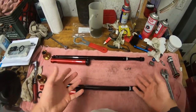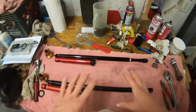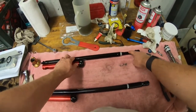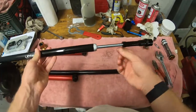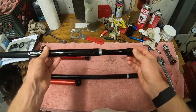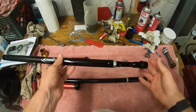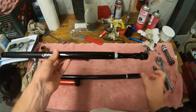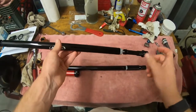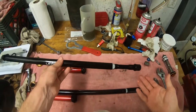The old version of their ORSS off-road suspension system is this one up here, and you can see these are very, very similar. But the difference is there's no bottoming cone in this — it's just a spindle and a guide rod for your spring. When this bottoms out, it's a hard metal-on-metal bottom. The way the air fork bottoming system works is there's only a bottoming cup on the damping leg, and that bottoming cup is in the bottom of the fork in the foot. It's very short travel — maybe an inch of your suspension travel is in that bottoming cone, and it's a very weak bottoming cone.